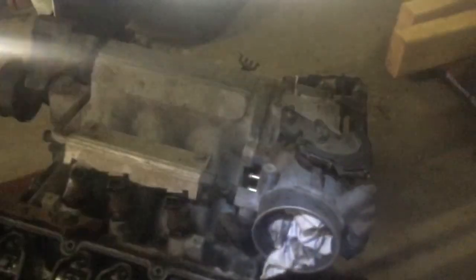That gasket's actually not bad. This motor had a bottom end knock before it got pulled out of the car - I think it was on a manual trans as well, it was in a VR ute I'm pretty sure. So that's off. What I'll do now is - there's still a fuel line on it but I'll take the fuel rail off and take the injectors out because that's what I need. Then I'll pull the throttle body and all that off and then do the other side exhaust, get the power steering pump and all that off.